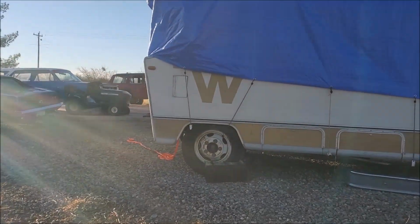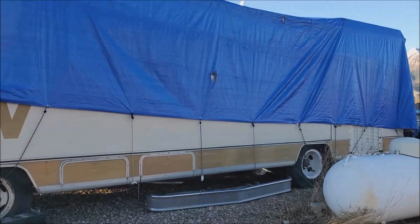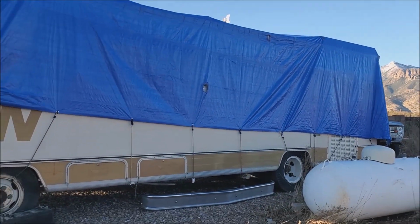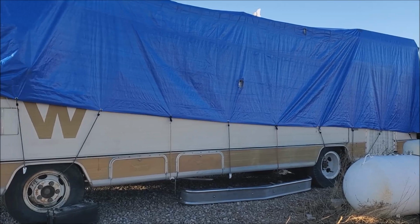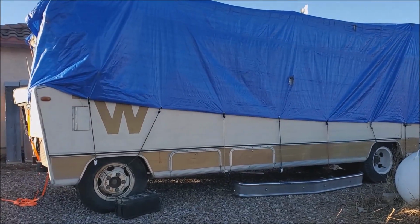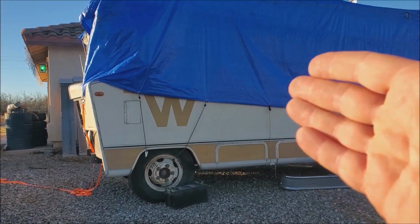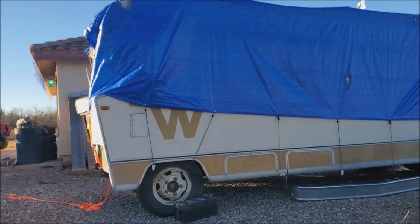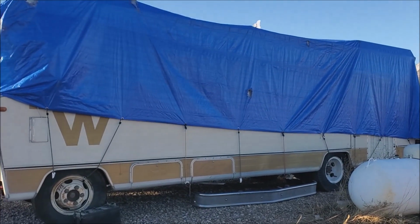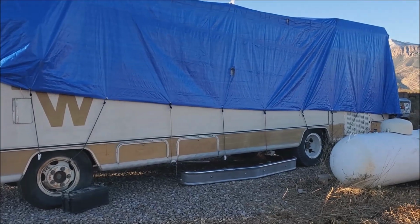So if we go with four-wheel drive axles, we need a way to push the fluid to those calipers and drums if we end up going with rear drums. I don't know if we're going to go with rear drums or rear discs. Why don't we use a modern hydro boost up front and just power it off the power steering pump? Cool. All right. Now we got a plan. Then we delete all that extraneous bullcrap that's prone to failure underneath.